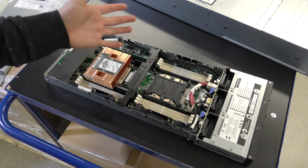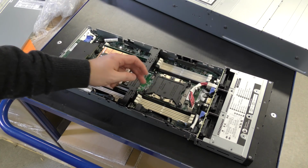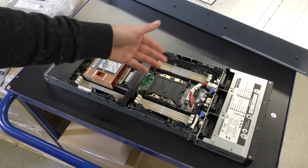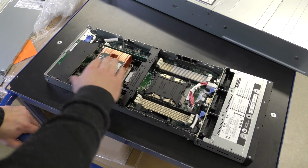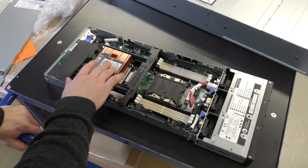And it's really not that big of a deal, because if you start using that memory DIMM, well, the memory speed will also be decreased because you are then using an unbalanced setup. Funny thing is that they have placed the CPU number 1 in the back of the server. That is usually always in front of the server. That must be something new.